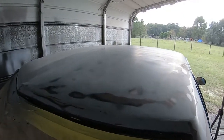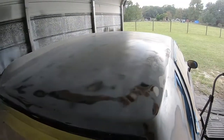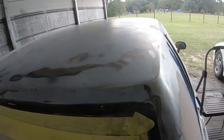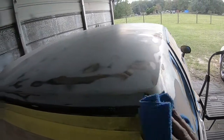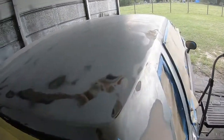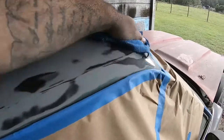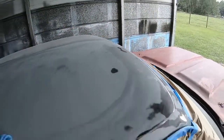I don't need to re-read the directions of the prep all again, but I can see the marks where the water is drying on there - whether it's supposed to dry or not - and that's what did me in on the Camaro. I also know on the Camaro I probably shouldn't have been doing a prep all type of wipe down before primer. Just a tack rag is all I should have done - I guess that was me being overly cautious.